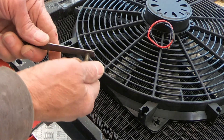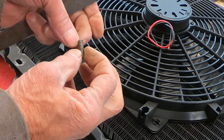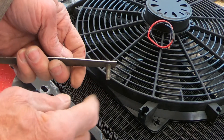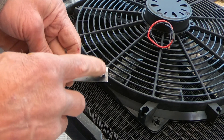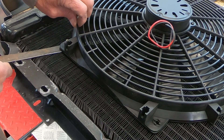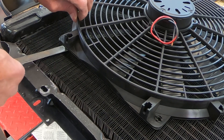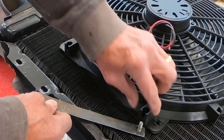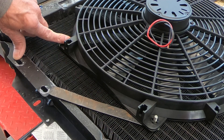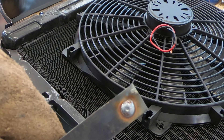Here's what I think I'm going to try to do. I've got these little straps, and I drilled a hole and tapped it for a quarter-inch thread. So I've got these little studs that I cut — threaded rod — so I'm going to screw that in there just enough where it kind of comes through a little bit. The thread alone won't hold it since this is fairly thin, about 50 thousandths, but now I'm going to weld right here and then grind it off smooth. Then I can let this pop through here — I'm going to drill a hole out here to match — and that's all that's going to hold that upper. I'm going to do the same thing down here with a longer strap, come up to this hole, and I'll have four straps. The radiator's on an angle like that anyway, so I think that'll hold it in place. I just welded this up, and now I'll grind it down smooth.